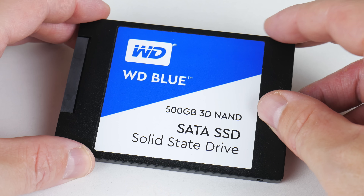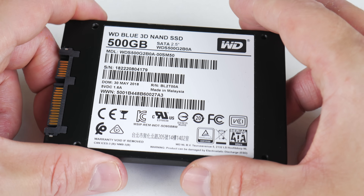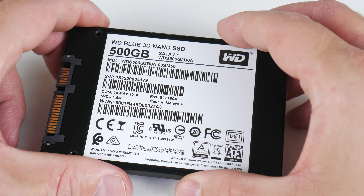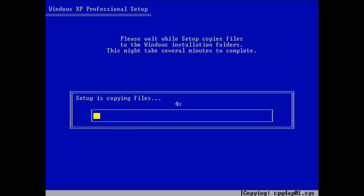To make sure games load fast, we're going with an SSD. I partitioned and formatted it on a modern Windows 10 computer with a USB 3.2 SATA adapter. That ensures the partitions are aligned, and then when installing Windows XP you just choose the option to not change the file format.